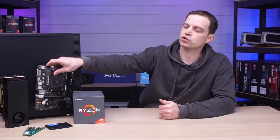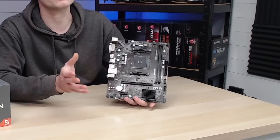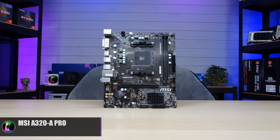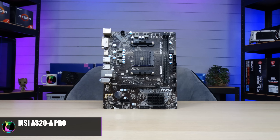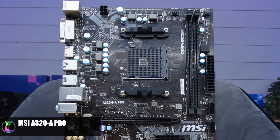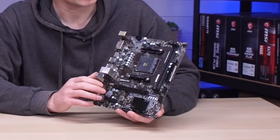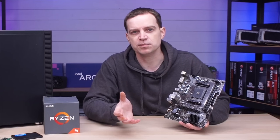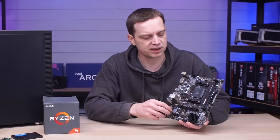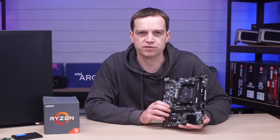For the platform we are going with AM4, and I managed to pick up this motherboard from eBay for just £25. It is a very basic model and one of the very first editions — it's an MSI A320MA Pro. This board will support many different Ryzen CPUs but is limited in what it can do. We only have two DIMM slots, and there's no M.2 slot as the board predates when those were really introduced into the A-series, but overall it's going to work for us.